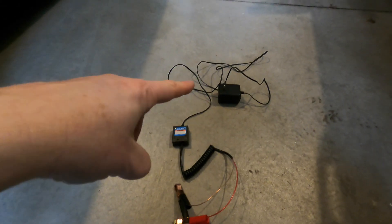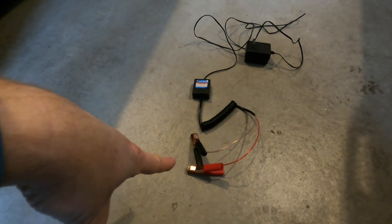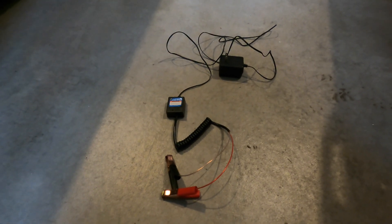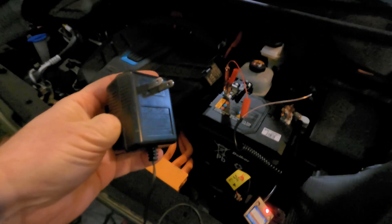If your car is going to be sitting idle for a while and not on a charger — like in a garage or some other place where you do have access to a 120-volt outlet — one of the things you can do is put a trickle charger on it. There is a part that plugs into the wall, a little box, and then a couple of clamps that go onto your battery. This is not meant to jumpstart a battery; it's a float charger, so it's just supposed to maintain the voltage of a battery over time. One clamp on the negative terminal, one on the positive, and then this end just goes into a regular outlet.